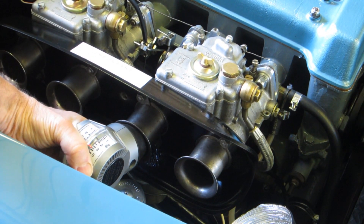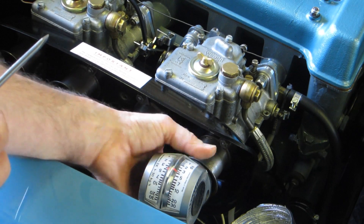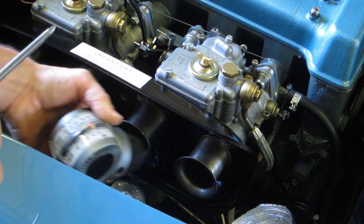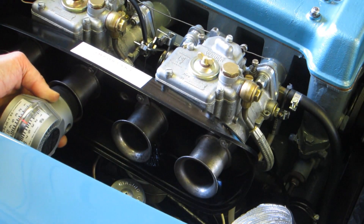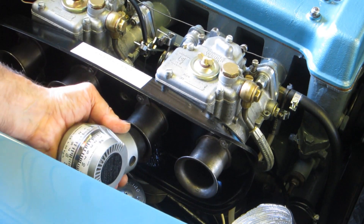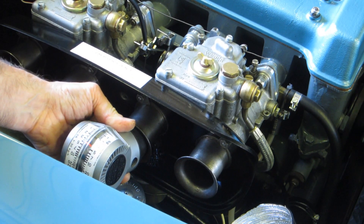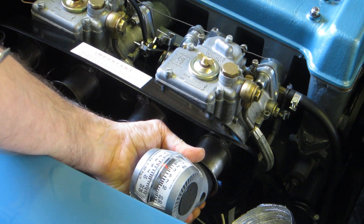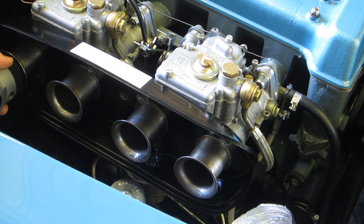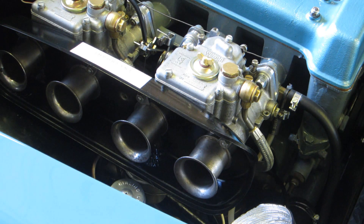You can immediately hear it sound better — that's about three and a half. It's a bit tricky on this end run so I'm not getting an accurate reading. Readings are now three and a half and four, three and a half and four. So just over three and a half, just under four, about four. Definitely needed doing — interesting that they're not perfectly balanced within each carb; I'm pretty sure they were closer than that before.